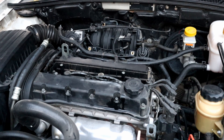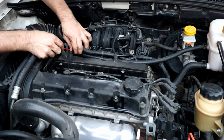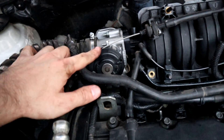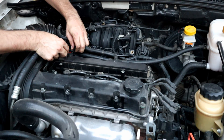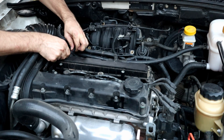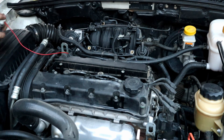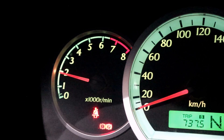I'm going to start the engine and let it reach ideal temperature. Using the carb cleaner with a straw inserted into the PCV valve hose — it has to be after the throttle, otherwise you will get a check engine light. Hold the RPM at 2000 and start spraying the carb cleaner.